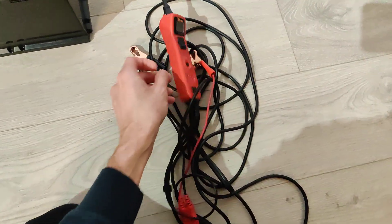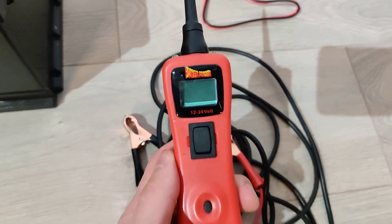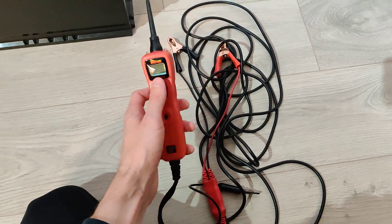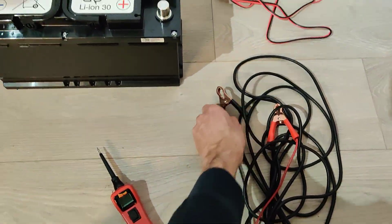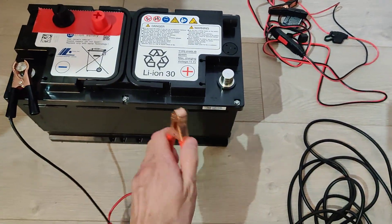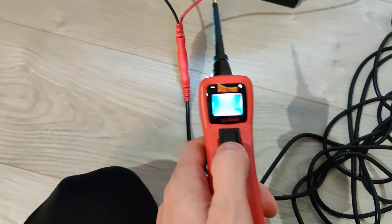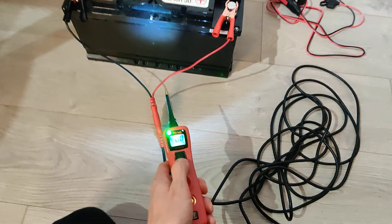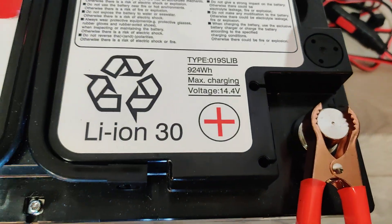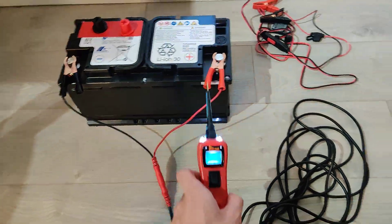The next tool you're going to want to get is a Power Probe — the Power Probe V3, also on Amazon. This one basically allows you to check voltage and actually apply voltage. I'm going to show you guys that this battery is actually good as a test battery. We got our negative, we got our positive — this battery is at 14.1 volts, which is the maximum voltage on this one, so this battery is pretty healthy.